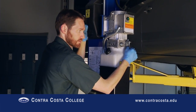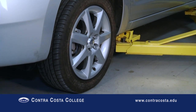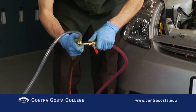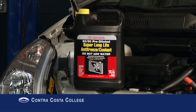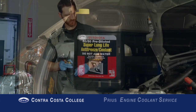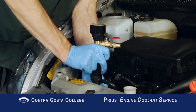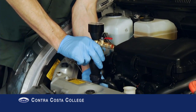Lower the vehicle. Prepare the airlift by priming the coolant suction hose with coolant. Toyota Super Long Life Coolant, used in the Toyota Prius, is already mixed with water — do not add water. Connect the airlift to the radiator neck with the appropriate adapter, and again support the radiator neck from below while you twist on the adapter.